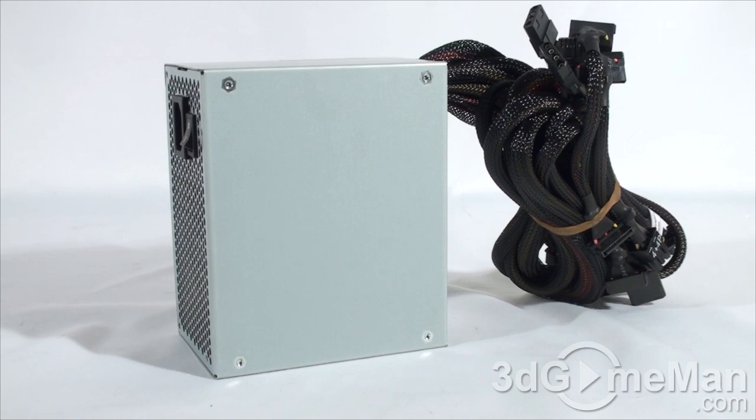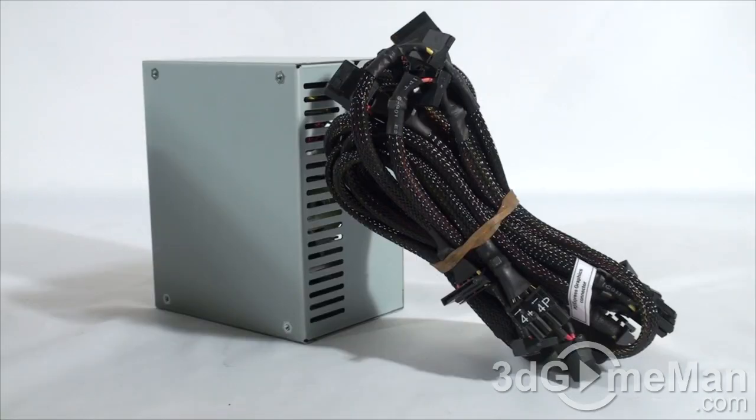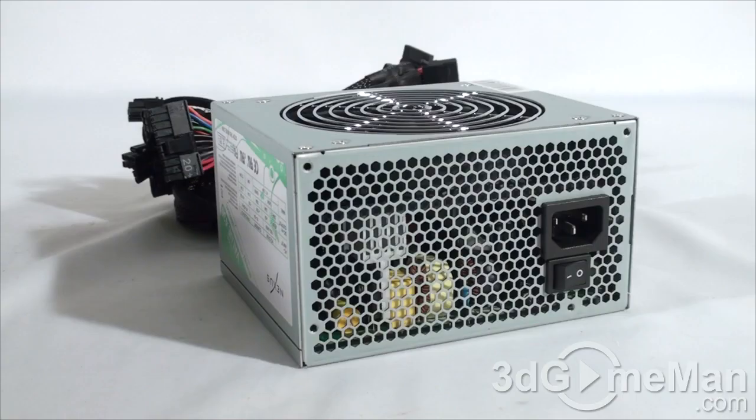Fourth, I'd recommend choosing a power supply that has APFC — Active Power Factor Correction. APFC assists the power supply in being more efficient and therefore stable under load. It basically reduces total harmonics, corrects input voltage, and allows for full input voltage range. Thankfully, this power supply has APFC. Finally, get a power supply that has enough leads for your setup. Consider a modular design, or at minimum make sure the leads are sleeved, as this reduces cable mess and increases airflow. Also get a great warranty — this power supply comes with a two-year warranty.